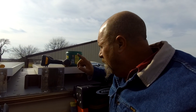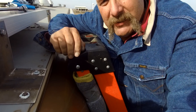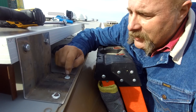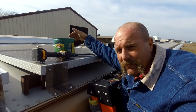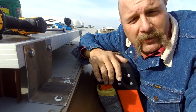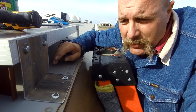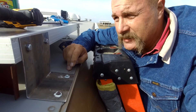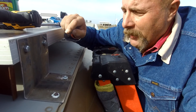All I'm having to do is drill through this aluminum right here. On the roof here, this is an aluminum skin on top — I thought it was stainless steel but it's aluminum. The channel inside is aluminum too, and then this skin out here is stainless all the way down the side. Stainless is hard to drill, so instead of drilling through all this stuff, I've just been drilling through the rivets — the aluminum rivets. And just dumb luck, the spacing worked out perfectly.